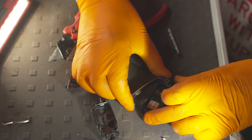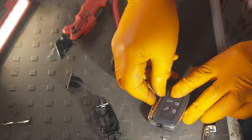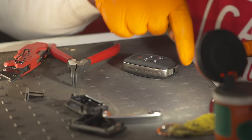So we've already got the battery in place, so that's fine. So that all goes together. So then all we have to do is make sure it's around the right way, that top. Like so, and then finally pop in our key, of course, vital important. Just there we are, just pop that into there. It just slots in. And then, oops, I'll put it down there. Well, look at that. Our refurbished key fob looks fantastic, particularly as I've retained the Range Rover engraving on the side. So now let's see if everything works.